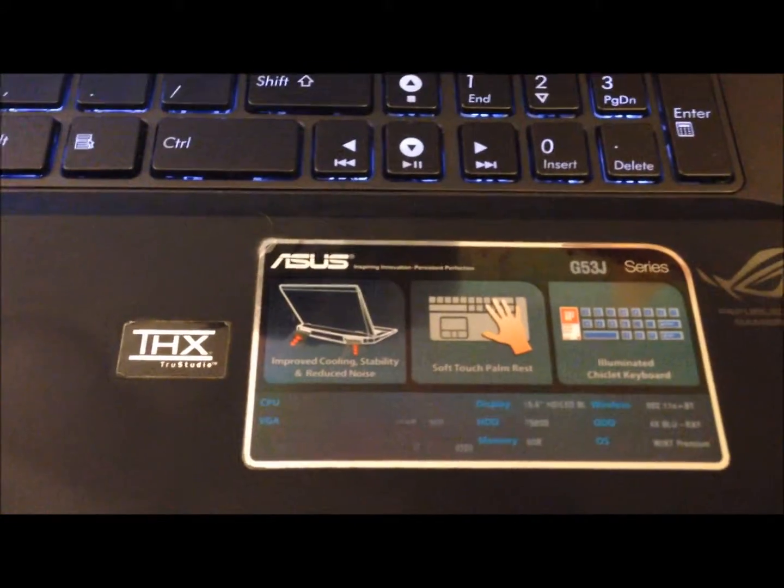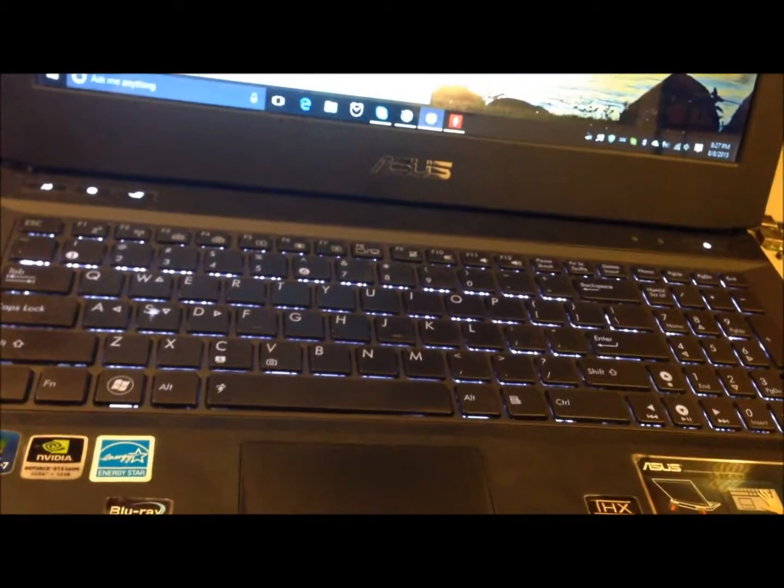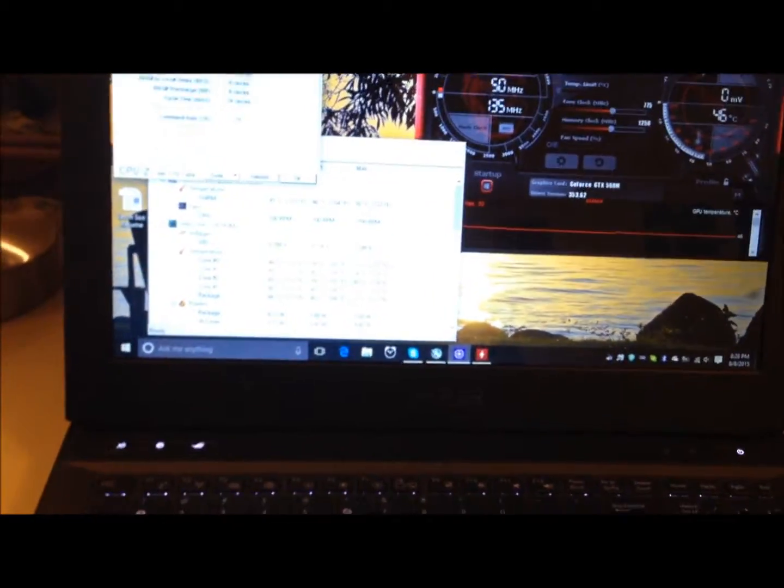And because Asus, if you have the same chassis, or at least the same series, the G53 series, or any series for that matter, pretty much uses the same components. They're fairly similar, if not exactly the same. So swapping in and out shouldn't be an issue, as long as you swap out whole components, such as the whole motherboard with the GPU and CPU attached. I don't think you can desolder. You could try, however, I don't think it'll work, and I also don't recommend it. Yeah, swapping over whole components does seem to be working.